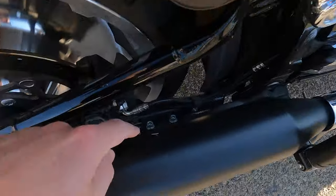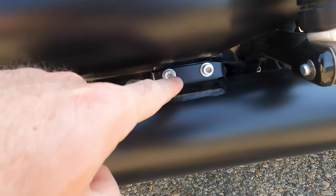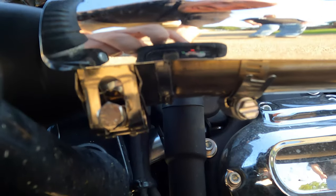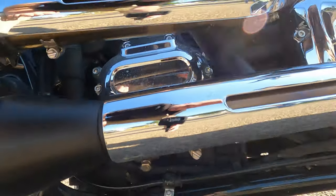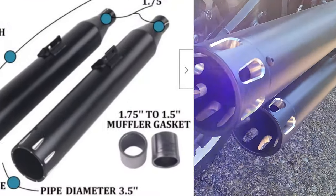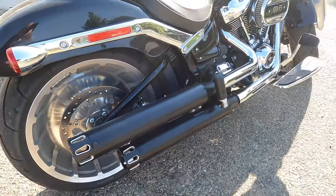You're just going to remove these two screws and then right below that, these two screws. And then there's two clamps holding the exhausts on. So you're going to have to loosen this one and this one up, which will allow you to pull the stock ones off and slip these right on. I did have to use the two included gaskets for the inlets.